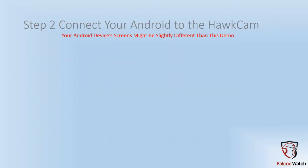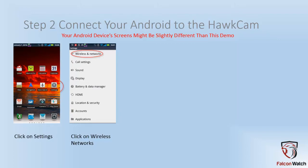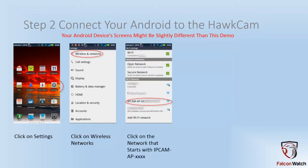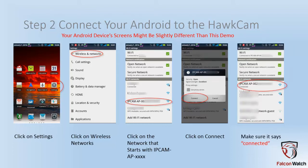The next step screens might look a little different depending on who your manufacturer is, but the idea is still the same. Click on your settings on your Android device, then go into the Wireless Networks setting. When you see the IP Cam AP-00 network — the rest of it will be different for each camera — click on that network. If your screen prompts you to connect, go ahead and hit connect and you will see the camera being connected. It's important that before you leave this area you actually see that it says connected. If you don't see the IP Cam network in your list of options, wait until the camera has a slow steady blink on the front. If it's still a fast blink and a pause, it's still booting up. If it's a solid blue light, that means it's already connected to your network and you don't need to do anything.